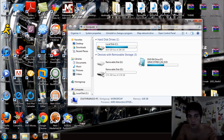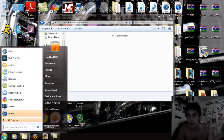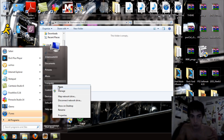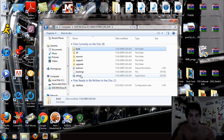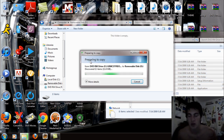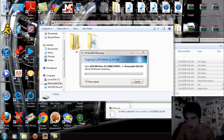If you go to your removable drive you're going to see that it looks empty — that's totally normal. The boot manager file that was just copied over is a hidden system file you're not supposed to see. Now go to Computer, open up the DVD drive, select all the files — click the boot folder, hold Control and Shift to select everything — then drag and drop to copy them all over to your removable drive. That's going to take a little while depending on how big the files are.